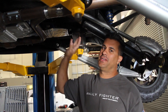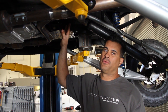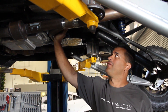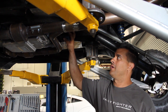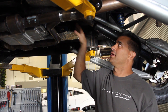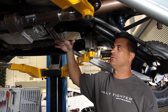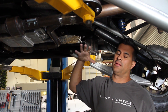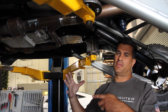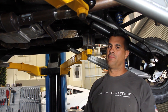For this transmission to fit in the Rally Fighter frame — which was made for a four-speed or three-speed — we actually had to cut off the frame brackets and refabricate brand new brackets, and also refabricate a brand new transmission drop to get the proper plunge angle. If you have too much of an angle, transmission oil sits back in the pan and you get overheating problems. It's a domino effect: once you change one thing, you have to change another, and it keeps going down the line until everything is right.